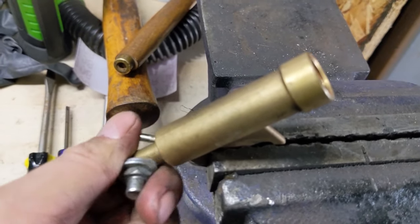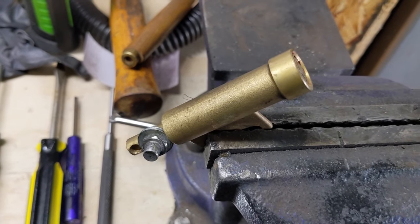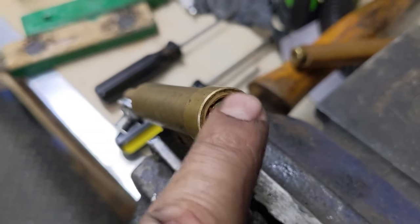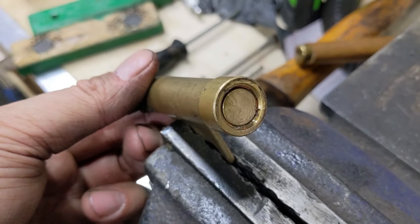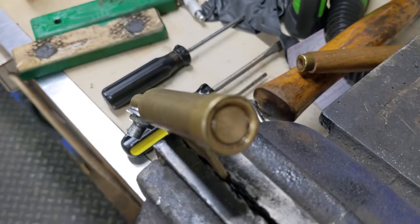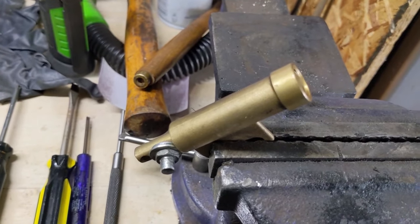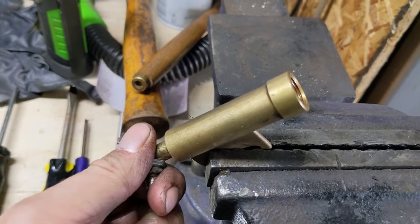There is going to be a spring in there, so the piston will always return back to the high RPM stage — the air pressure pushing forward is what throttles your engine down. With it off, I wipe away a lot of the red Loctite the factory uses, then pull down on the piston and put a little bit of 3-in-1 oil in there and work the piston up and down to make sure it's lubricated properly. Sometimes these pistons can seize, so if your compressor runs but won't kick down or up, it could just be a seized piston.